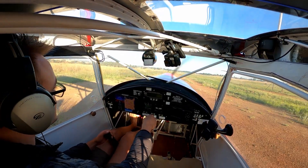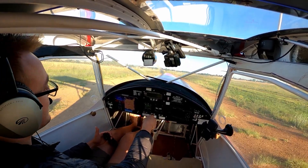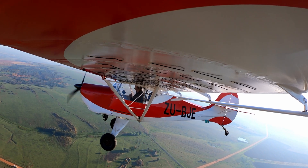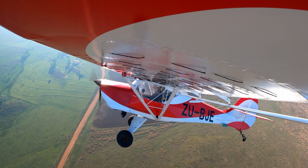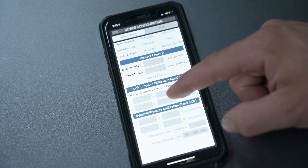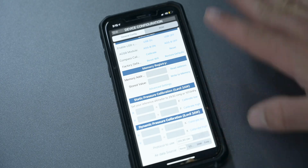Overall I found the app to work really well and easy to use — there are a few things I'd like to see added or improved, but I'll get to that later. After setting everything up it's time to calibrate the compass and the artificial horizon for install errors. During the first flight test there are two things to calibrate: the compass and the artificial horizon. You fly straight and level for the AR calibration, then fly two orbits of about 40 seconds each for the compass to calibrate, and then save it. Almost everything in the Level Aviation unit is adjustable or calibratable.